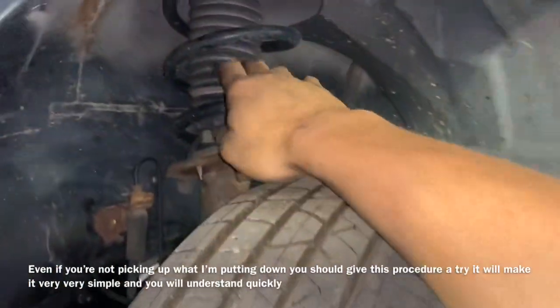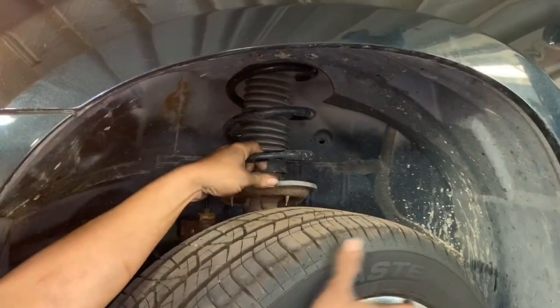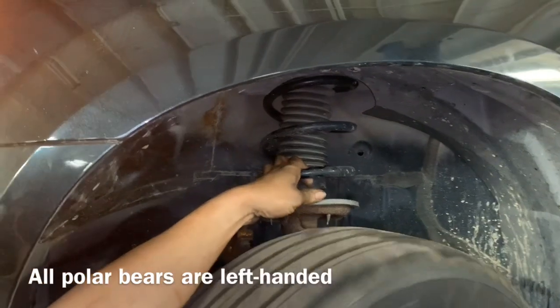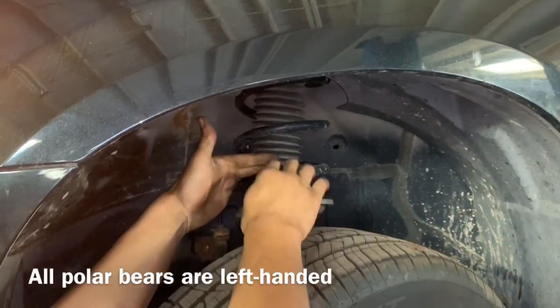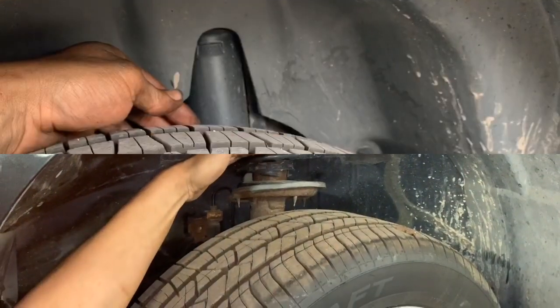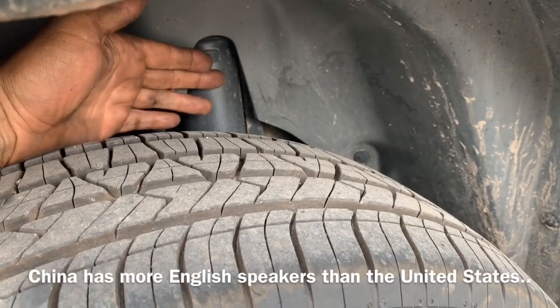You can simply take your other arm while holding on to this one. When you're spinning the wheel, you're going to feel energy transfer and you're going to feel a vibration in the tips of your fingers right here if you have a bad wheel bearing.